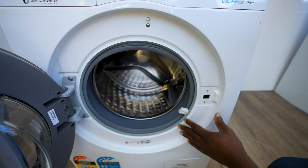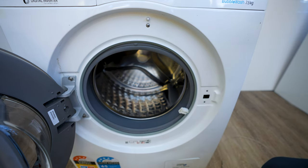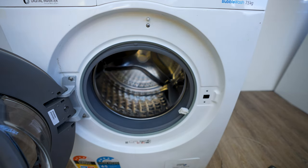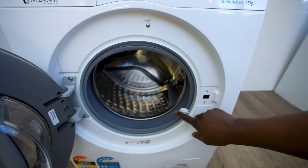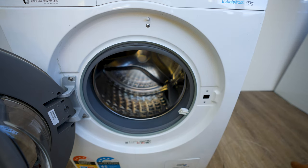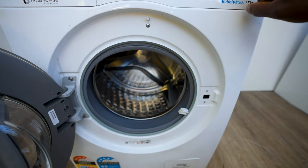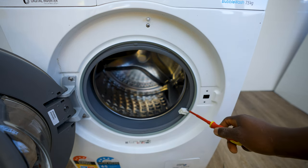Normally if there's a fault you have to look elsewhere before you conclude it's the main board causing the fault. I don't think it's the main board at this point. You're supposed to get 240 volts coming from this, but on mine there's nothing — though I'm not going to conclude there's a fault with the main board just yet. I want to check something else.